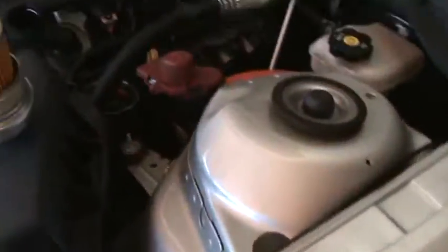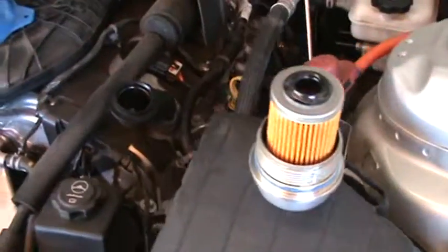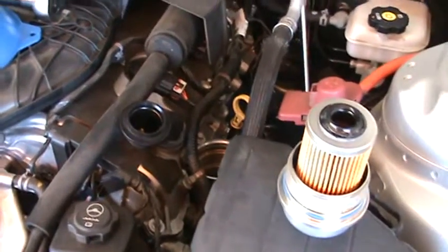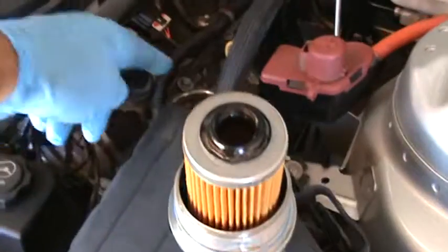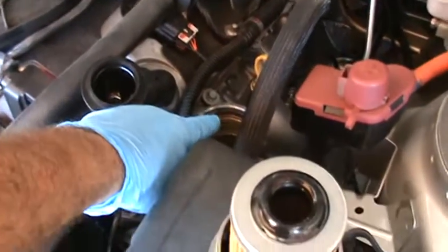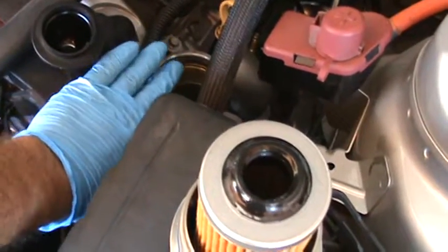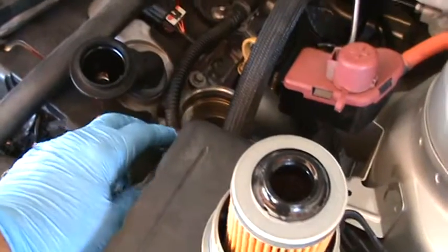According to oil manufacturers, synthetic blend could have one part synthetic and the rest conventional. I can afford full synthetic so I just use it — not a big deal. The Corvette uses it too. When you tighten the filter cap, don't over-tighten it — there's no gasket, so just get it very snug, don't torque it down.